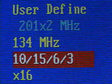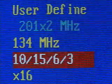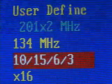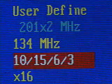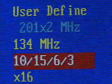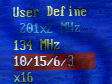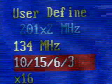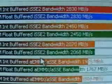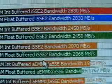So I had to use this external clock and divider ratio just to show how I was able to get the memory above 200 MHz. I got this at 201 MHz — here's how: take 134 and divide by 10, giving 13.4; 13.4 times 15 gives you a DDR frequency of 201 MHz. The AGP bus is 13.4 times 6 equals 80.4 MHz, and the PCI bus is 13.4 times 3 equals 40.2 MHz. Using those settings for the OCZ AD 3200 memory, I'm getting a result of 2830 megabytes per second — not a lot higher than the AD 3000 result.